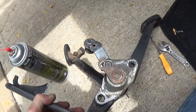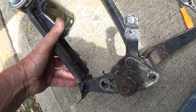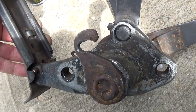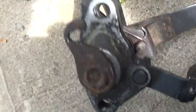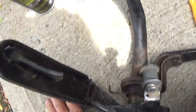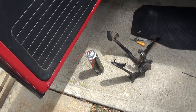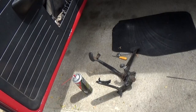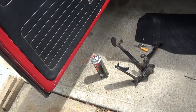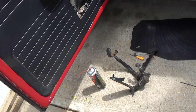I'm going to take my wire feed welder and build up this hook, then file it down and use a burr to try to get that thing back in there. Those are 17-millimeter heads — you'll need a 17-millimeter socket or box-end wrench, 12-point would be nice. Not something you want to do trail-side, I'll tell you that.